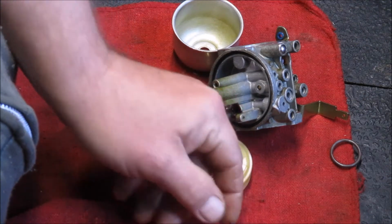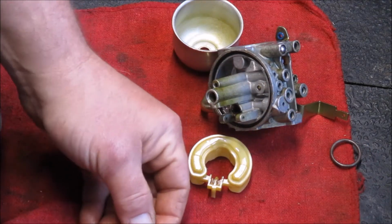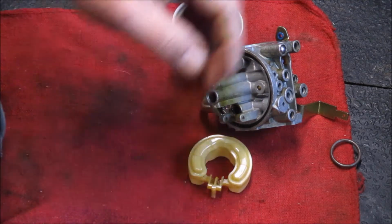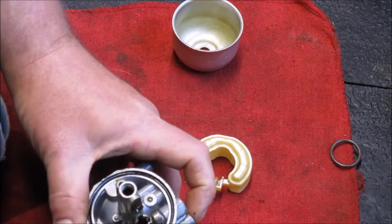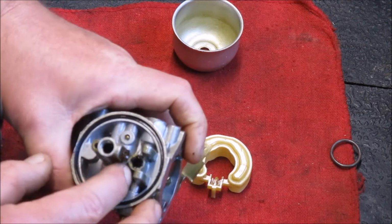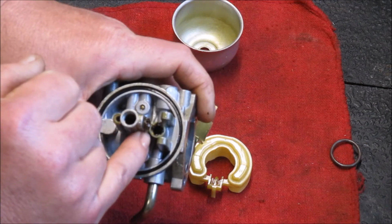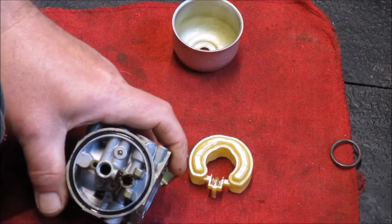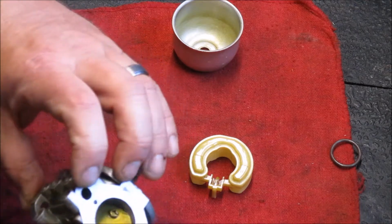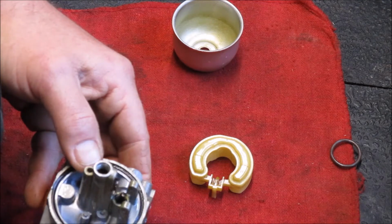If you think about it from the perspective that this is the method through which a 13 horsepower engine gets gas, this is a substantial amount of blockage. It's a very, very small passage, and I guess people think of fuel traveling through more of a hose as opposed to one of these little bitty jets. Or down here, the needle seat, it's called, this little bitty piece of brass down there, and the opening is no bigger than that hinge pin. So that's the problem with this carb. We can say that almost definitively. I wouldn't think it would get any worse.